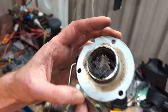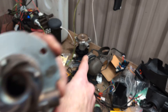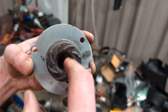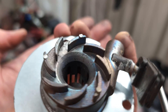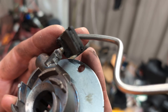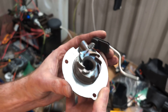There's a lot of stuff in there — it is pretty horrendous. This is the back end with that disc taken off and you can see the fins where your centrifugal fan blows through. It makes a swirl of air directing it through the hole through the burn chamber. You can see there are slots of various sizes — big ones and little ones all the way round. And there's one that's a lot longer than the rest where the glow plug is.